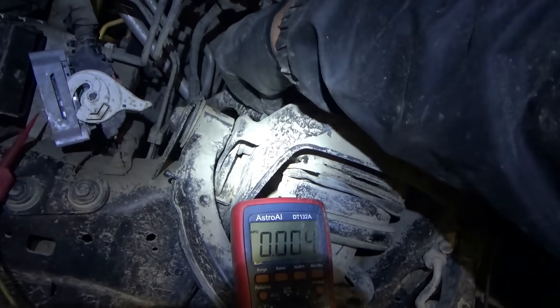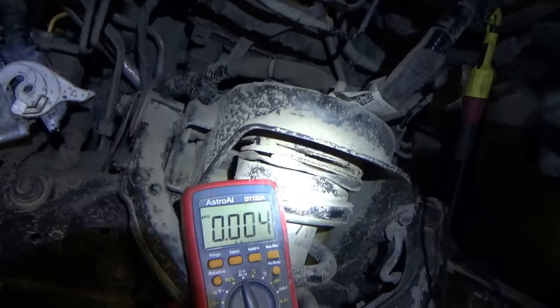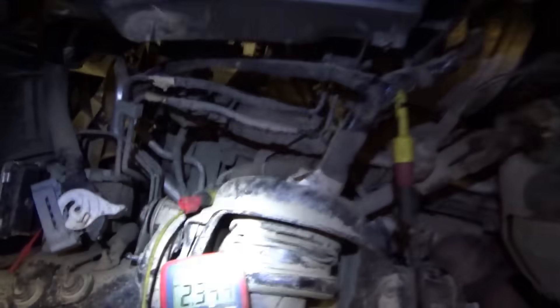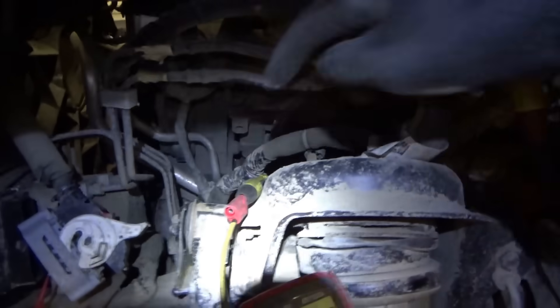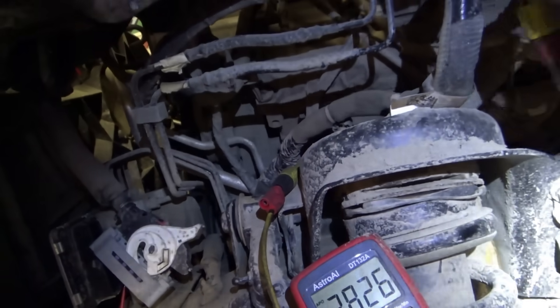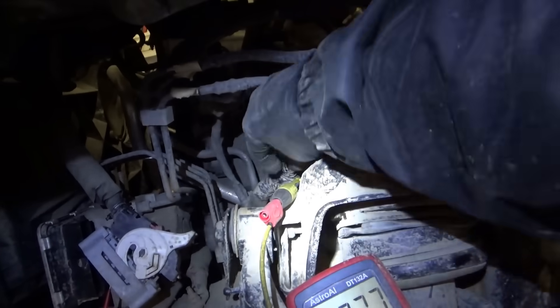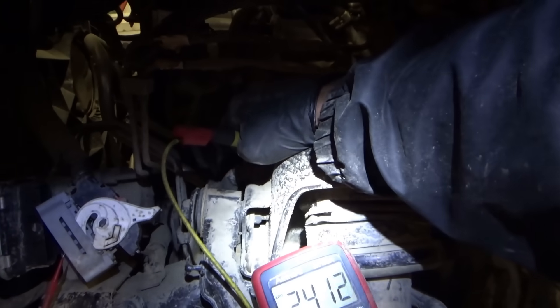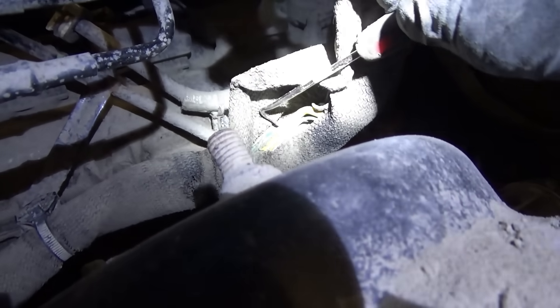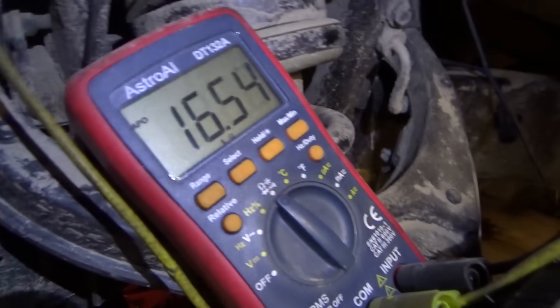We have the harness exposed right here. We can probe from here to here. Let's try that and we'll seal these pinholes up because this environment is not friendly. Poking the probe in right here — the problem is in this stretch, from this probe to this probe. We know the wire is bad. Unwrapping the harness right here at this bend — see that little green crusty? When we snap it, the ohmmeter goes: boom, open circuit.